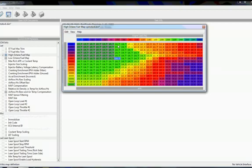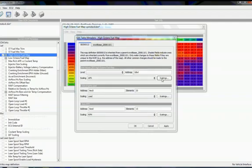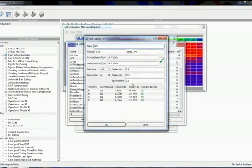And you can select multiple cells. Say we had these two guys and we wanted to add. We can hit the increment button on the keyboard, and it will go up. Whatever that AFR scaling has defined as an increment value is what it will go up by. So if we go back in to edit this map once again, and we look at the settings for this AFR scaling, this will bring up the increment edit is 0.1.